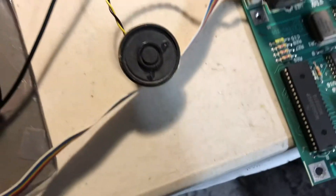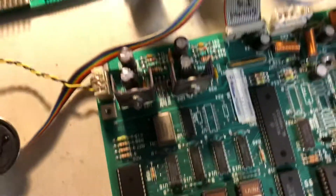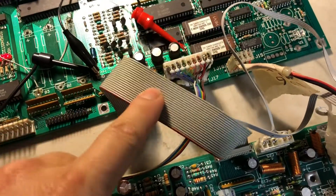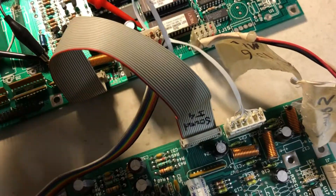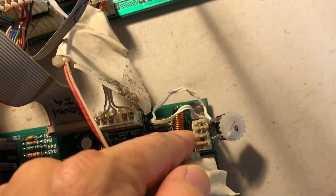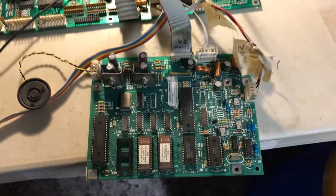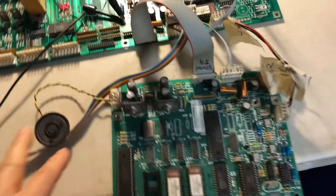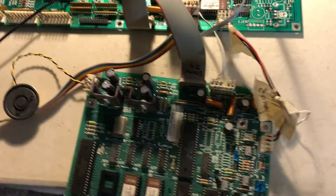So all the sounds work. Let me turn down the volume. The customer's ribbon cable is being used, and the sound cable. I have my own power cable, my own volume control, and speaker. So perhaps the problem is in those three — either the speaker, the volume control, or the power cable to the soundboard.